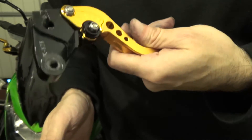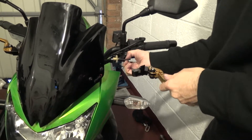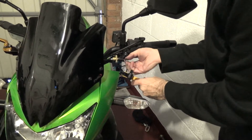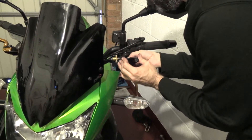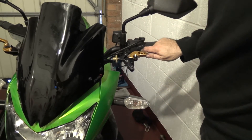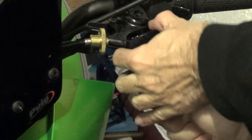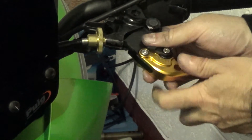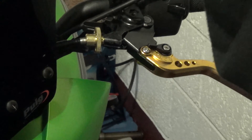And then I need to reverse the process — put this back on the bike. It should be a simple case of... never is, is it? That needs to go back into the little holder. Pretty hard to show you, that's quite tight, so you have to trust me. There we go. So you can see the end bit of the cable now into the brake, just here. And I can turn the entire lever over, slide it into roughly the right position, get the cable there so it slots back in nicely. Now it really is just the reverse procedure for putting the brake lever back in. And before I do that, I have to wipe my hands a bit.